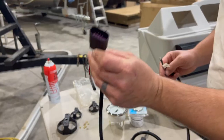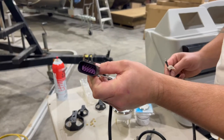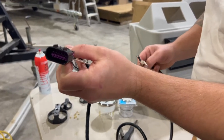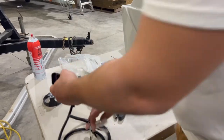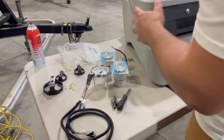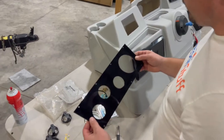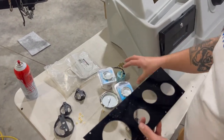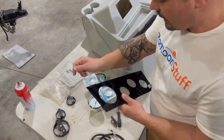Conveniently, this big plug is going to plug right into the ignition harness for my motor — the plug that says 'gauges' says it right on it. It's already run underneath my helm. I'm going to do all of this work and get it installed so that all I have to do when I put the helm on is plug this into my ignition harness. This is going to be my face, so I'm going to flip this over and install each of these gauges in their respective holes before I do any wiring.